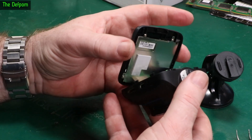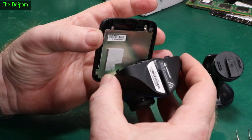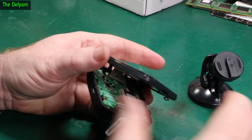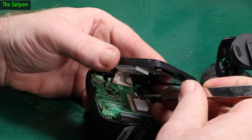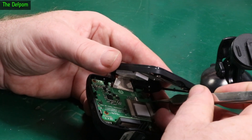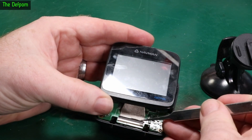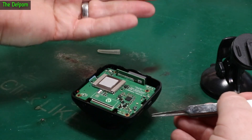So there are two little flex cables for the screen. There's a GPS module. Because it's got a touchscreen, obviously one flex is for touch. I've lifted the tape off the connector, and that pushes the tabs out of the way. Lifting the tab — that's out. This one here is probably the same deal: lift the tab. There's the screen off.